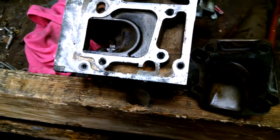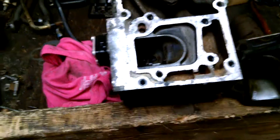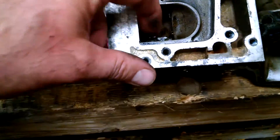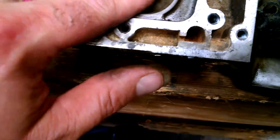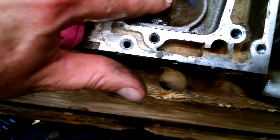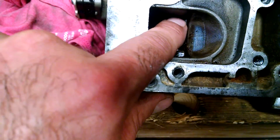In an RC car, you would refer to this as getting it on the pipe. Basically, there's roughness in here — we're going to have to get all that out. There's all this from the casting, all these edges and stuff. You want the air to just flow smoothly and the sound to not get interrupted. So we're going to take off that little edge in there.